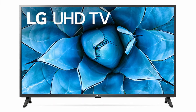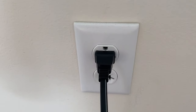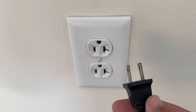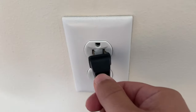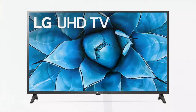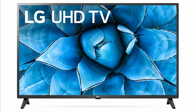The first method is an easy fix and in most cases it will probably fix it and you won't need to go on to any others. It's basically unplugging your TV from the wall outlet. Now wait 60 seconds — don't be impatient here, wait the whole 60 seconds — and then plug it back in. This will reset your TV. This is a lot different than switching the power on and off with your remote, so make sure that you do it from the wall plug.